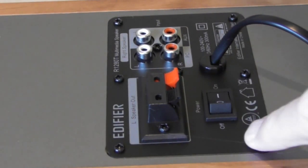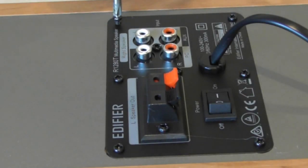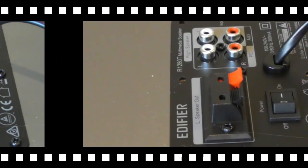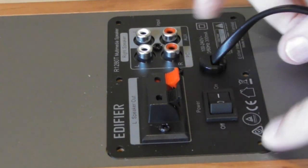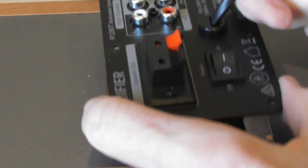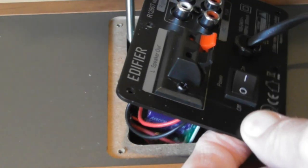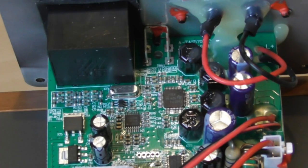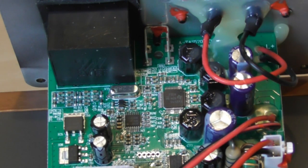This is the back panel. There are six screws here — just small wood screws — and removing these should, with a bit of luck, expose all the internals, hopefully all attached to the back panel. Several minutes later all six screws are out. It comes out very readily. You can see a wire caught up there, and I've come to the conclusion that there's probably another board deep inside, because that is clearly the amplifier.